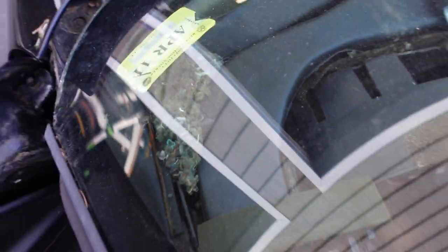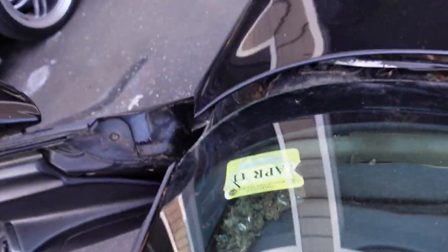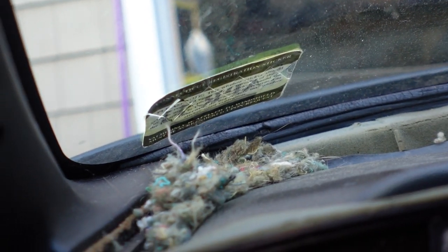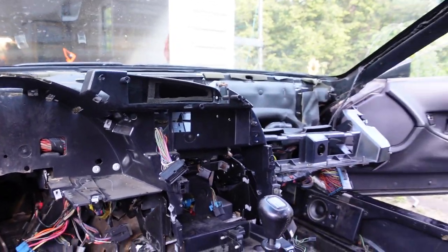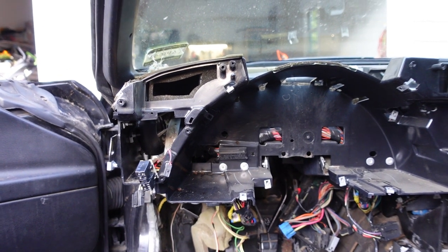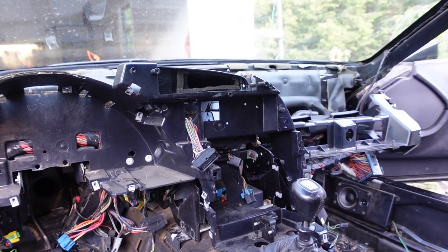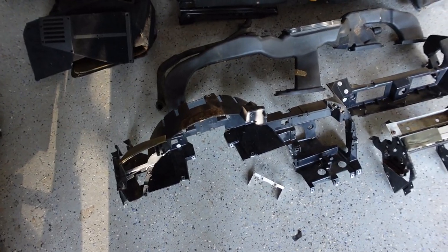Here's another look at the nesting material that's behind the dash - something you'd totally never be able to see with the dash pad on. It's all hairy and nasty. When you have a rodent-infested car like this, you've really got to go everywhere - take the whole dash out - because that stuff is always in there and it smells. All the droppings stink. You've got to get it out of there; as nasty and as much work as it is, it's worth it.